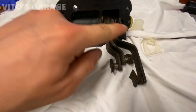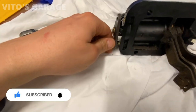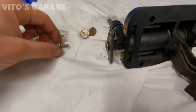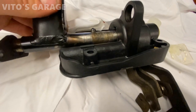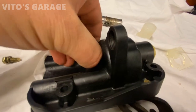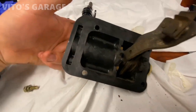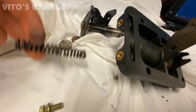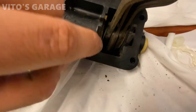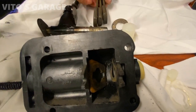Just take good pictures of this so you know how it goes back in properly. There's a spring inside as well — there's some change in here that wasn't able to get out until now. You're gonna take this out carefully like so. There's a spring — I'm gonna have to clean everything and get it all lubricated. To remove the spring you have to lift these up one at a time and then you'll be able to lift the spring out. It's pretty nasty, needs to be cleaned up and greased. Once you take the spring out, you can start lifting that washer piece and all three pieces out.